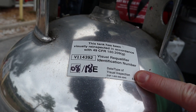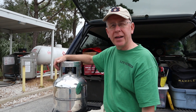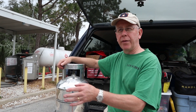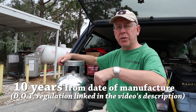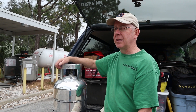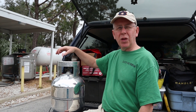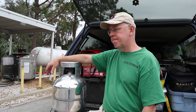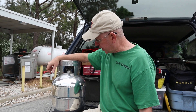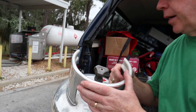You can see mine — I'm on a five-year recertification program, recertified in August 2018, so before August of this year I'll need to have this tank recertified. It's 10 or 12 years initially from the date of manufacture, and then every five years after — I'll leave a link to the exact DOT regulation. For recertification, large propane dealerships will do it — that's where we go in Vermont. Our tank was made in August 2004. They'll inspect for rust — though ours is aluminum — plus any damage, dings, and they'll confirm you have the correct OPD valve. Full propane, we're good to go.